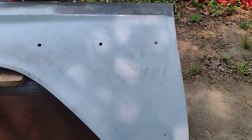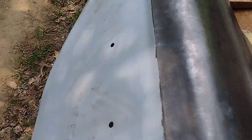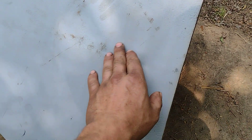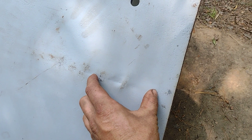I did go in here and work on this side a little more — tried to hammer and dolly this out. I actually took a little piece of wood — I know it's not a steel dolly, but it's the best I could do right now — and held it behind the panel and tried to hammer and dolly that crease back out. Got it out a little more. Still got a little bit of work to do, but we've got a brace that goes all through here so we can't really get to that area.